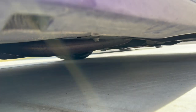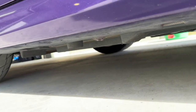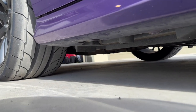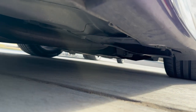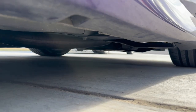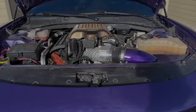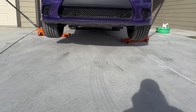You're going to look for a frame rail, which runs all along the vehicle. Pick a good spot close enough to the front of the vehicle, jack it up there, then go to the other side and do the same. You can see that piece hanging down — that is a great jack spot but it's for the rear of the vehicle. We're focused on the front. The frame is a great point to jack up at. Once the vehicle is secure and lifted high enough, we'll get underneath. I recommend putting jack stands with those jacks as well — there's plenty of clearance down there.